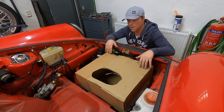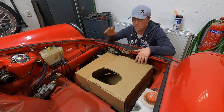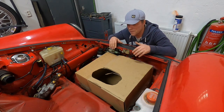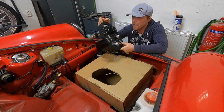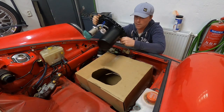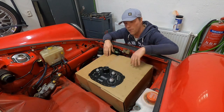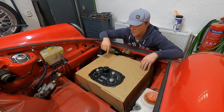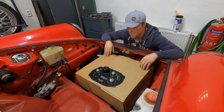The benefit of the fuel cell would be pushing the center of gravity forward and downward, which could help since I'm taking a lot of weight out of this compartment and that's not necessarily good when you have all the weight in the back. There are some safety concerns to address. This particular fuel cell unit comes from Nuke Performance — it has a lift pump and a catch tank with an internal fuel pump. This allows you to run the fuel tank completely dry without engine starvation, which you cannot do with a 964 tank. It has all connections neatly up top: fuel inlet, fuel return, a vent line, and a level sender. It also allows you to set up a nice center filler cap.